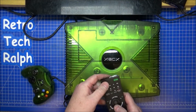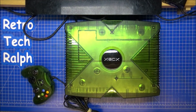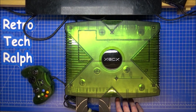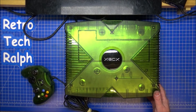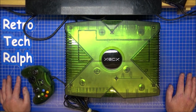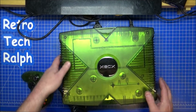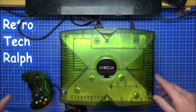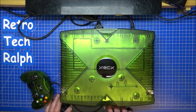This is the one with the black front. Power is on — good sight. It's not blowing up. Now let's press the power button on the front. She's flashing green. And she's gone red — error 16 again. So that's got the same fault as before. Maybe it does want — with it not being chipped — maybe it does want the capacitor. But that's actually working. The black front is actually properly working, but it's still got the same fault. So I've managed to cannibalise that one pretty well. I'll set up the other one, because this is going on eBay — let somebody else fix this one. I don't really need the parts, but at least that works fine.